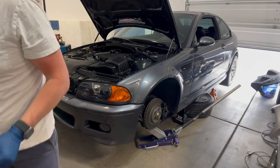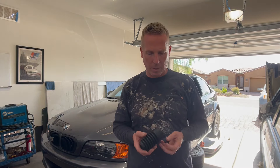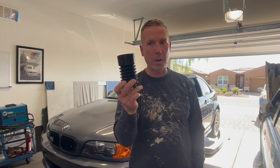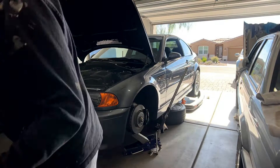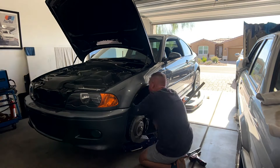This needs to be completely tightened down as well so that we don't lose our alignment specs — I don't want to lose those. Alright guys, so we've got our dust boot covers, nice and flexible, as well as our 20 mil bump stop. What that means is I just need to disassemble the top lower, put this on and that on, put it back together, drop the car, go for a ride, and then we'll talk about how much of a difference I feel.